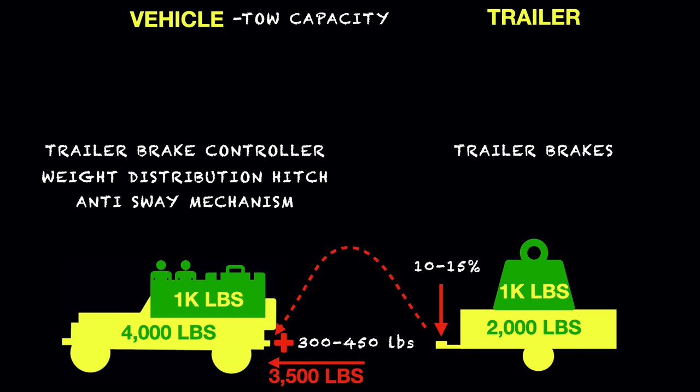Last but certainly not least, another item to take into consideration that I don't see talked about very much — and I believe might be ignored quite a bit — is the maximum trailer frontal area. In the manual for a Jeep Wrangler with a towing capacity of 3,500 pounds, the maximum frontal area of your trailer should be 30 square feet. This is due to the fact that the front of a trailer would act as a sail, applying stress to your engine and transmission when towing. Determining the total frontal area can be complicated with trailers that have V-shapes, wedges, or rounded edges such as bowler trailers.